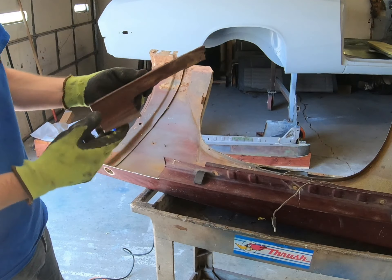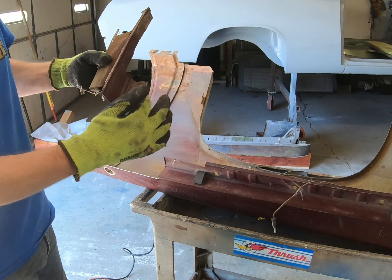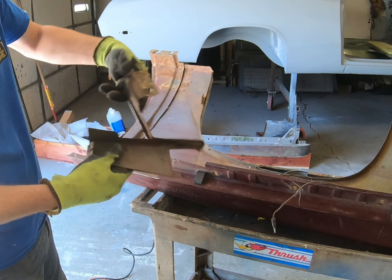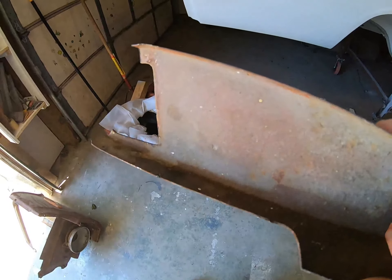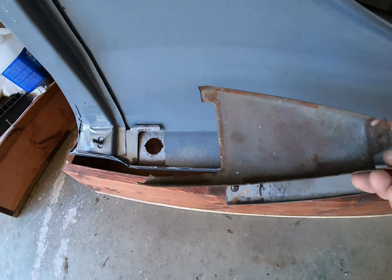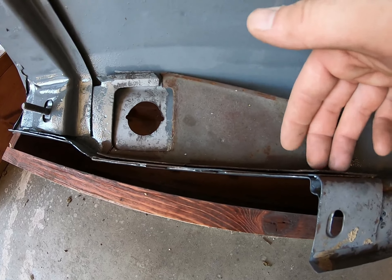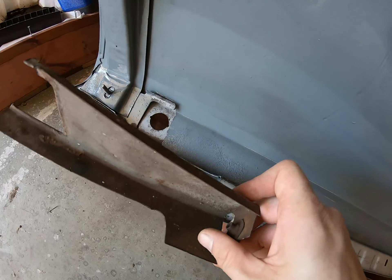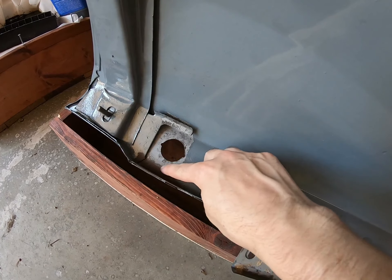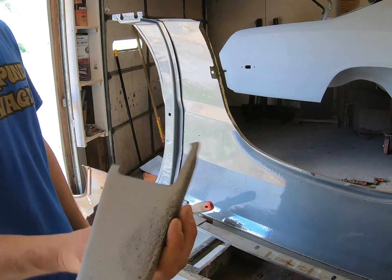I just want this part — I'm going to have to remove this flange. Part of the fender has a little rot on this rail that you see when you open the hood, so I can salvage this piece. Here's the piece removed. I buzzed some of the excess garbage off of it, trimmed it up, and it will soon fit right in there. We'll have to spot weld — plug weld — a couple spots here and here, then butt weld it there. I'll run it through the blaster first to clean it up really good, then hit it with our POR-15.